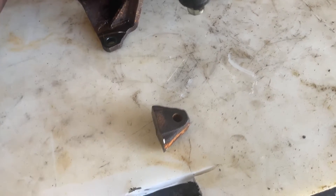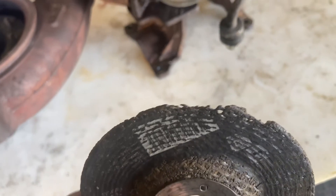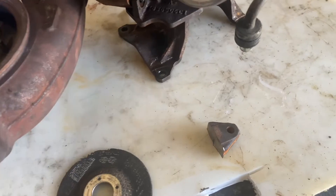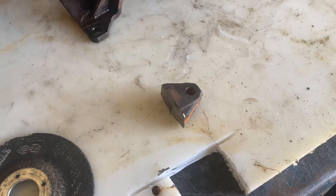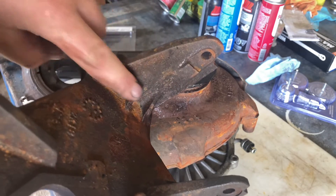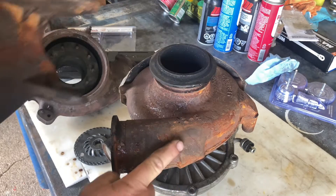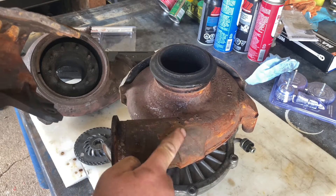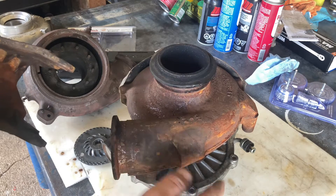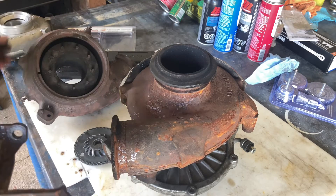It could potentially be catastrophic for you. You can see this disc here — it's not the one I used, the other one was totally disintegrated. Same fate here, it's busted, this is garbage — just wanted to show you as an example. So be careful and take your time when you're cutting that tang. On the back pedestal you have these two uprights which give it strength but don't give you a whole lot of clearance. If you cut this too tight, you're going to go through the case. There's a bit of a pucker factor working on this thing, because if I went through this case, that's probably $400 down the drain — what I paid for this used turbo.